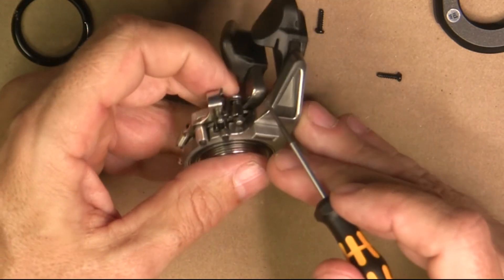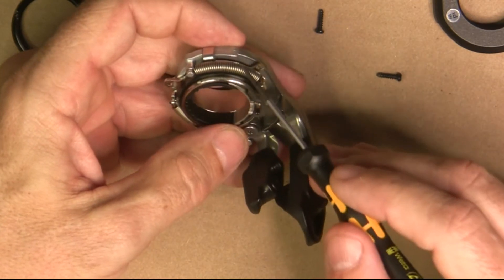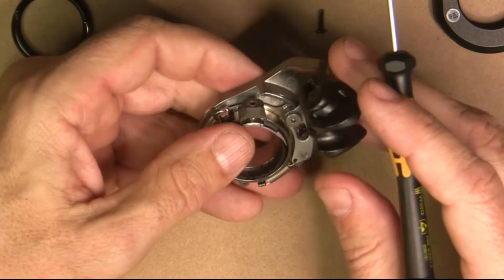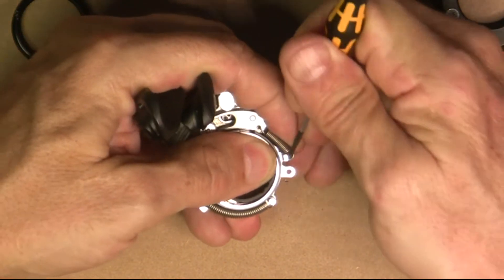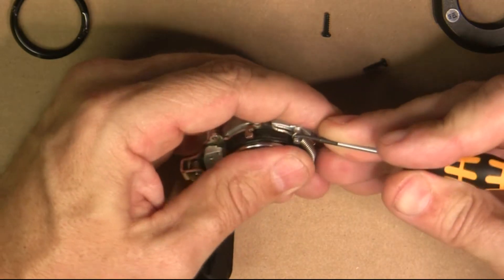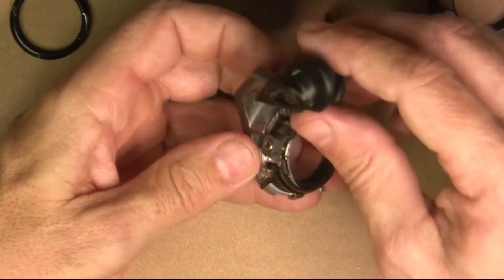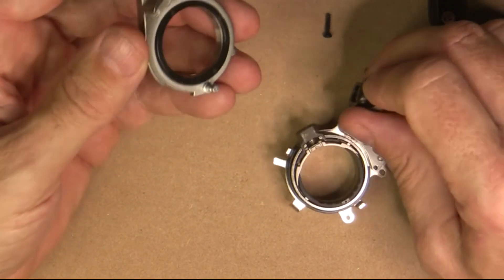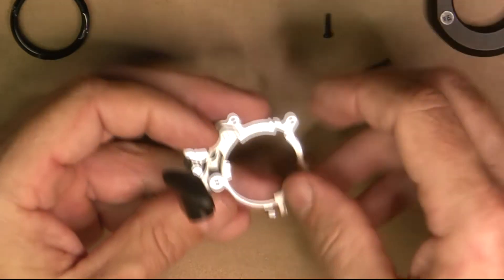To reduce the total pressure to activate the device, I have to replace both torsion springs and both extension springs. First, we're going to pull these extension springs off - the first one comes up pretty easily, and then the other extension spring we'll just take a screwdriver and pop that off. Once I have the two extension springs off, I can pull the two sliders apart - that comes with the back switch, there's a little ring, and there's the front switch which just slides right out. That's just the part that holds it onto the handlebar.